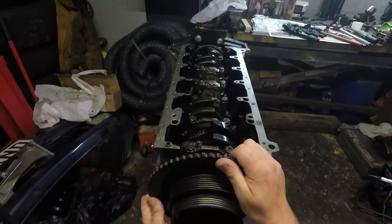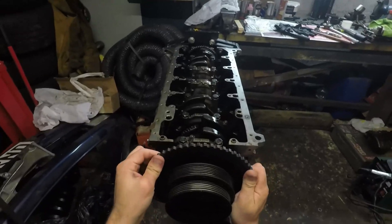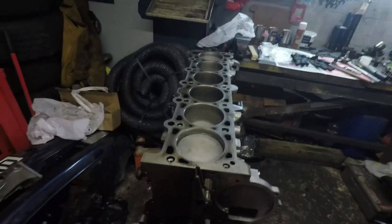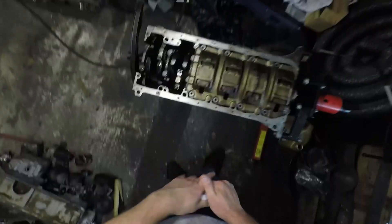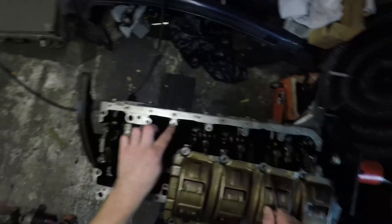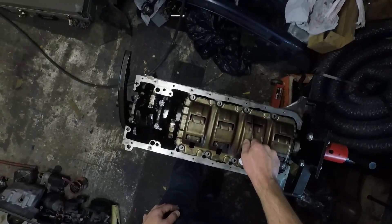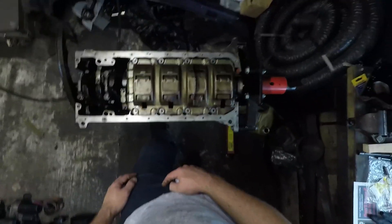Here we have a crankshaft with six pistons in, so I can stop panicking a little bit about the bearings. We'll have to replace another set of bearings in this job. It turns over nicely by hand and nothing seems to be catching. From this point forwards I'm a little stuck again because I'm waiting on a new oil tray and oil baffle plate. This M52 plate is unfortunately useless to me now - as you can see none of these bolt holes line up. I've had to buy a new plate for an M50.